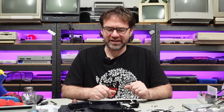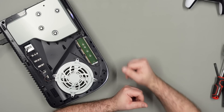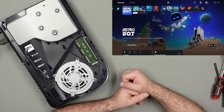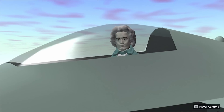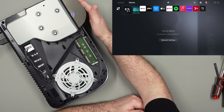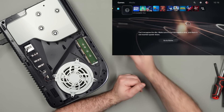Let's throw this back together and give it another test, though I really don't like our chances here. The console is reassembled enough to power it back on and it still seems to work — that's a good sign. The DVD still reads, so we haven't made anything worse. But the game disc still gives us 'can't recognize disc,' so we're at the same place as before. I think we're going to have to replace that laser assembly.